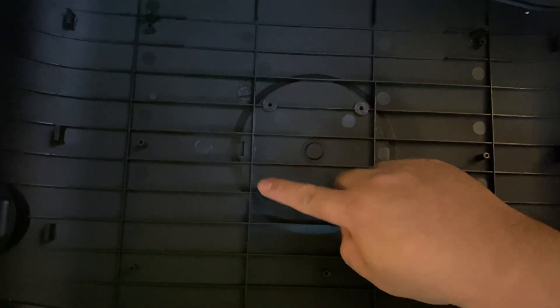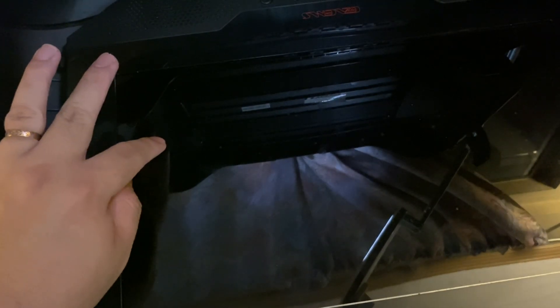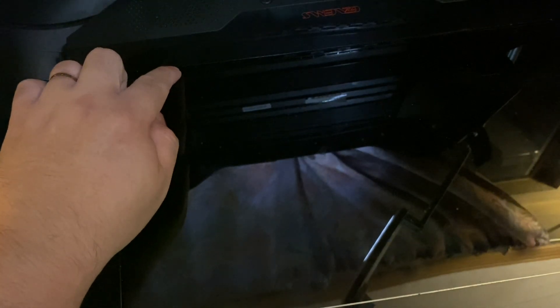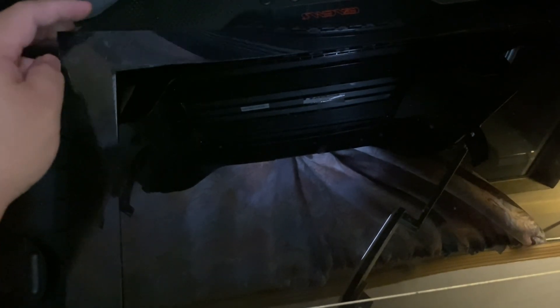Going back to first step: you need to remove the four T6 screws at the front holding the LCD. Once you remove that, the LCD will not be easily removed because there are more screws coming. Next will be the sticker plate that holds the screen in front — this black framing here. You can remove it easily with a plastic scraper. Since it's a replaced screen, you can apply more force going upwards and just start peeling it off carefully.